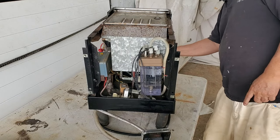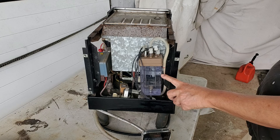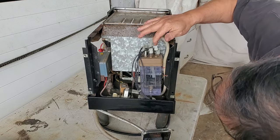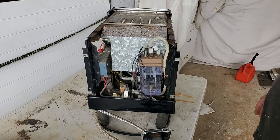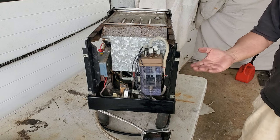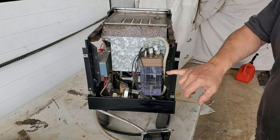I'm going to hit a dose - any setting. Watch the water go down. Okay, so it stopped. It hit the top of this particular probe. So it hit the top of that probe and it stopped. Now if I hit it again, it won't turn on because it's asking for water to refill again. Even pressing the dose button won't do anything because there's not enough water. That's how you know when it's dosing water.